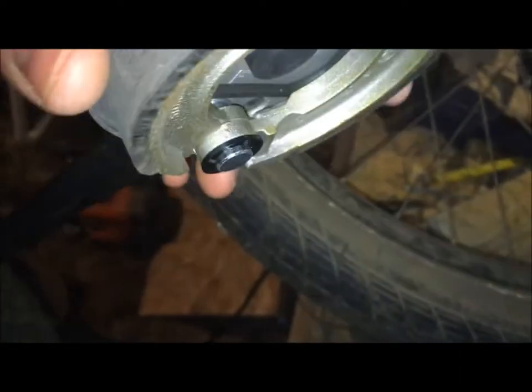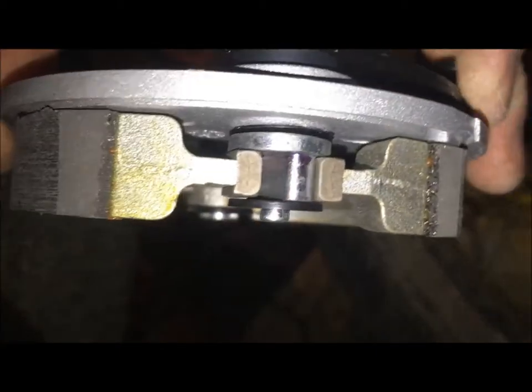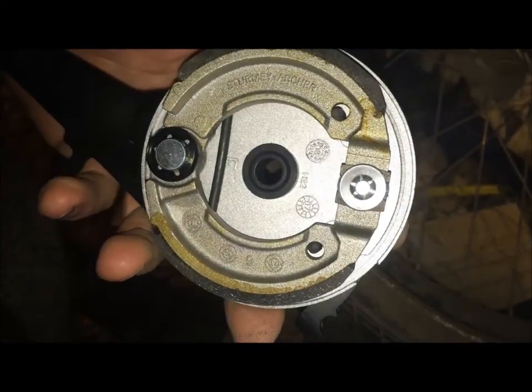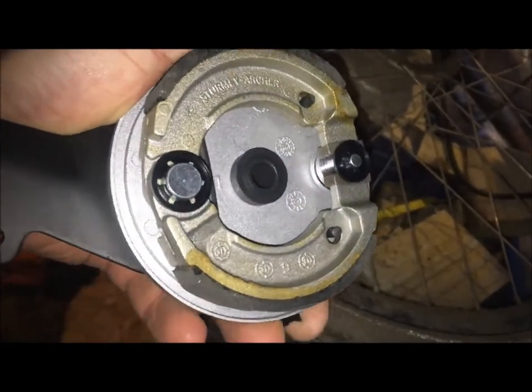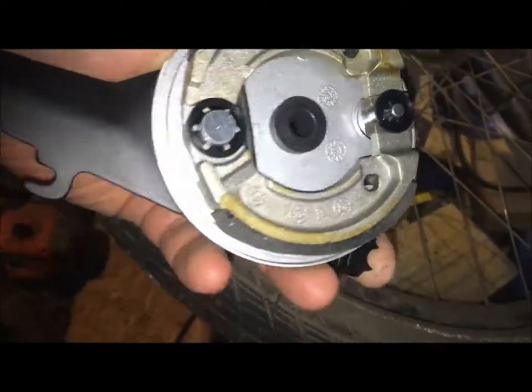This is the new set of pads, and just before putting them in, I thought I'd check whether this little cam thing here is lubricated — and it's not, it's dry. That would suggest you ought to keep it that way over the lifetime. I did notice when I opened up the old one, which I had lubricated, a lot of brake dust was all muddled up with the grease and had gone a bit sticky. So I think the answer is brake cleaner only inside — and if you're going to do a service in here, don't lubricate that cam, just use brake cleaner.